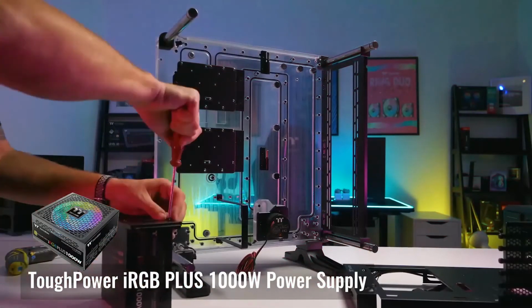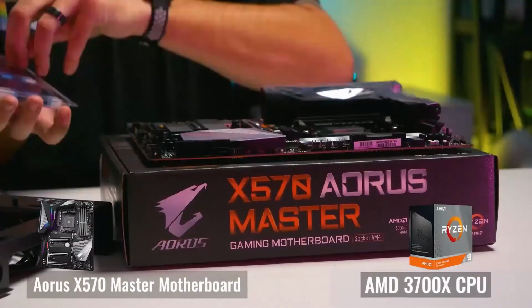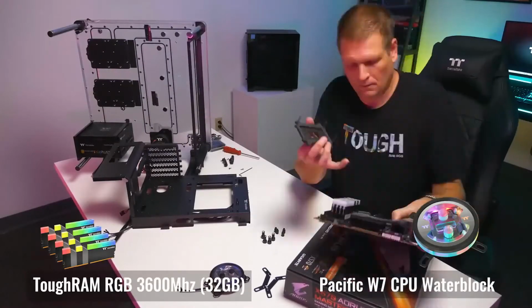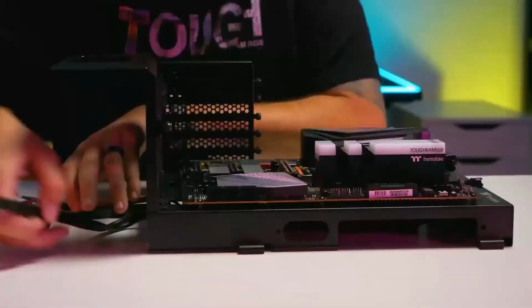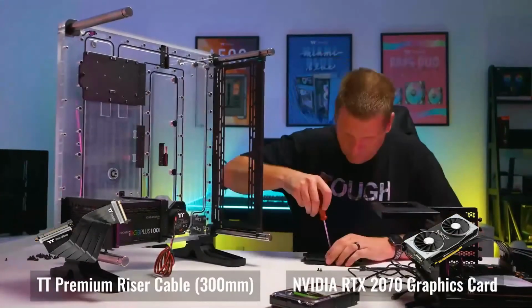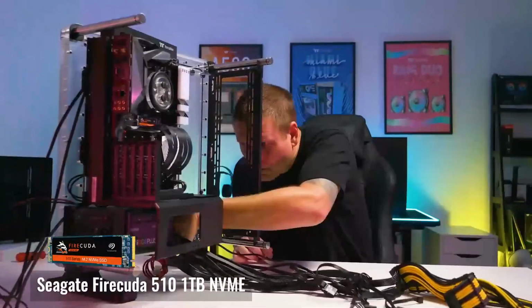The 350p offers a removable motherboard tray, which I'm going to say is an amazing feature. This allows me to install everything from my motherboard, all my components, right onto the motherboard tray, off of the case, protecting the acrylic. Great time to also install your power supply, and even the I/O panels, and everything's all right there on the motherboard tray, so it's all basically done. Then you have some great storage options in the back for 3.5 and 2.5 drives as well.